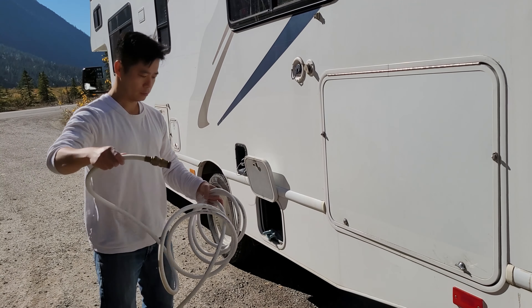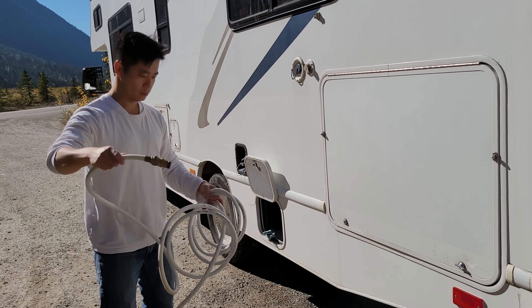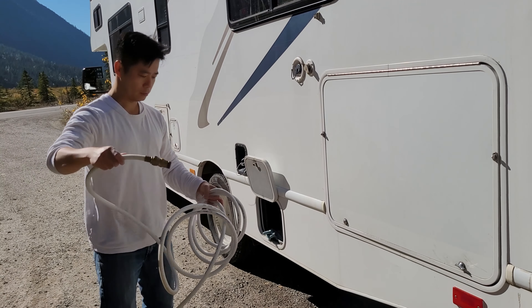I'm going to stop it now because that's enough water for me. That is how you fill a fresh water tank in any RV with a fresh water tank. I've taken the hose out and I'm capping it. Remember to cap this — one of the most common things is people don't cap it and it flies off on the highway. For a city connection full hookup, you want this thing in the front because it acts as a pressure regulator. It says 40 to 50 PSI — this controls the pressure from the water source coming into the RV, ensuring your pipes don't break.